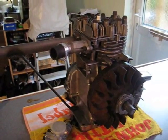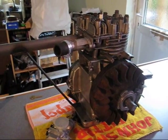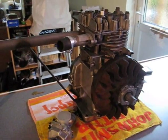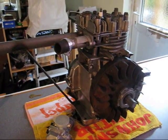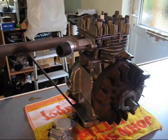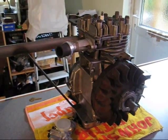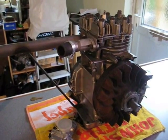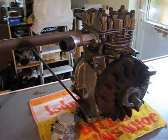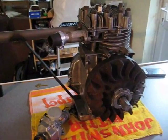So far I haven't milled the head down at all. It doesn't actually have a recess at the top of the piston — it looks stock and doesn't look like anyone's machined it before. Basically it's just flat on top and it's just got the recesses for the valves, so I'm not sure if it would actually be wise to mill it down any further. There is some space above the valves so it could go down a little, but it's got really good compression so I think I'll just leave it and maybe leave that as a later modification if needed.